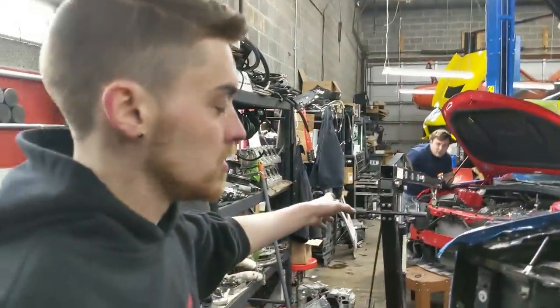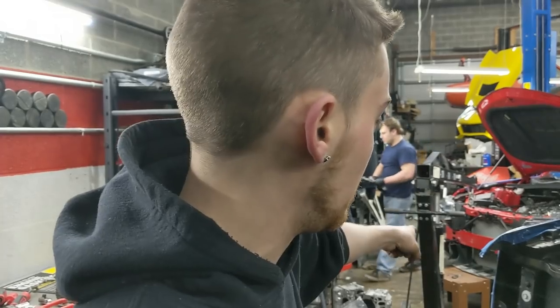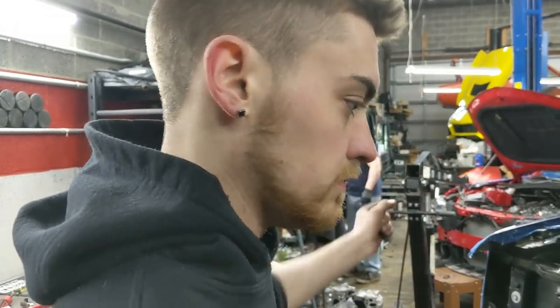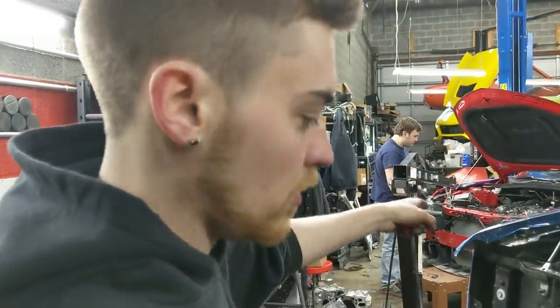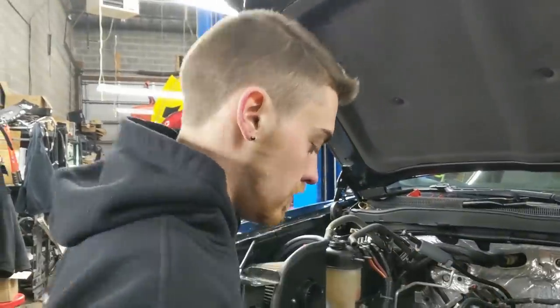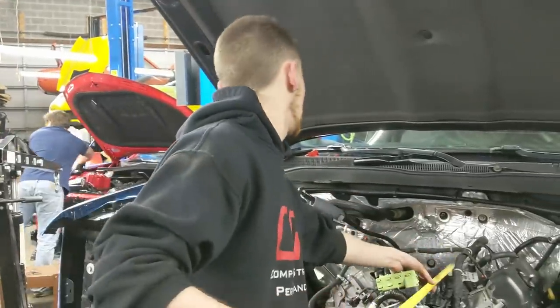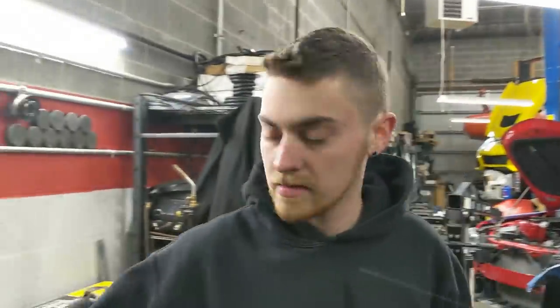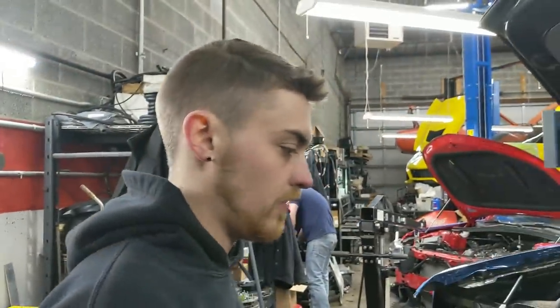So you took that off because the boom only reaches so far? The engine hoist is 43 inches from the piston itself to the hook. With that on there, it was 49 inches from the bumper to the hole I need to reach on the engine plate. So now it is 38 inches. Perfect, got an inch to spare. 5 inches.